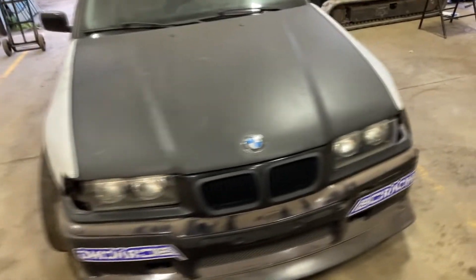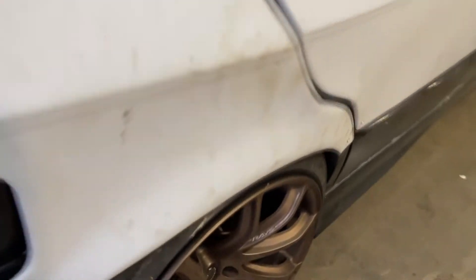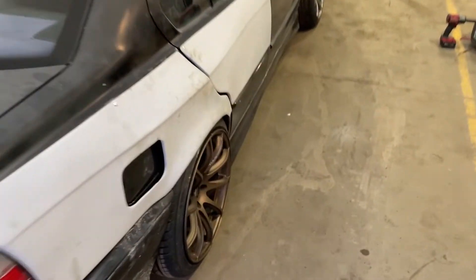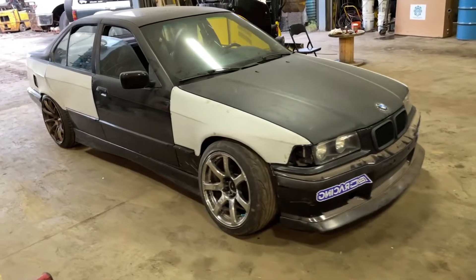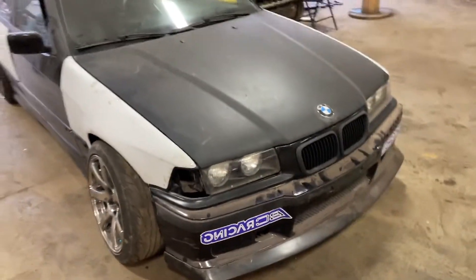Here's the car with the bumper and front wheels from my drift car on it — the fitment's pretty decent. In the rear, it's not bad. Once the camber arms come in I'll dial in some more camber, because it's still stock right now and I'd like to run as close to zero camber as possible for tire wear. Overall not too bad for a car I just slapped together. Next video I need to do the hydraulic handbrake and the dual caliper, then weld the diff and camber arm in, and throw in a spare bucket seat.